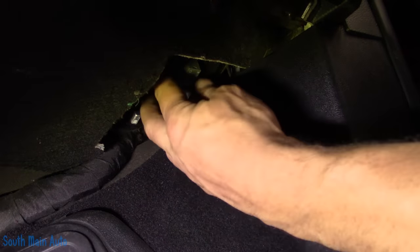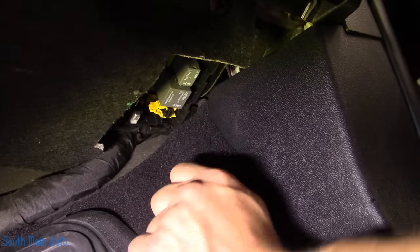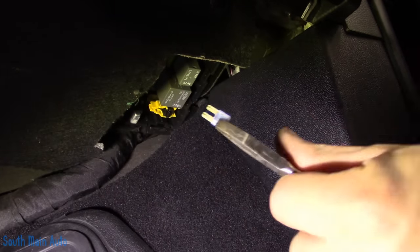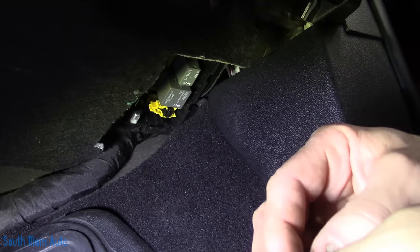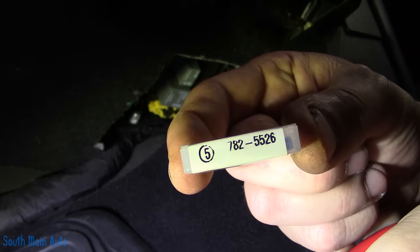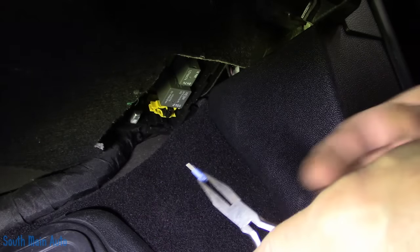Right now we are in the passenger side footwell — that's where your right foot would rest. There's a fuse box up under here. It's fuse 121, 15 amp. I came in here with a test light and checked the fuse — indeed it was blown. So I just took it back out and that fuse has gone corrupt also. Now I only have a few of these. I have no idea what they're called — that is the NAPA part number on them. Not a sponsor. Kind of an odd little guy. I must have run across this once before.